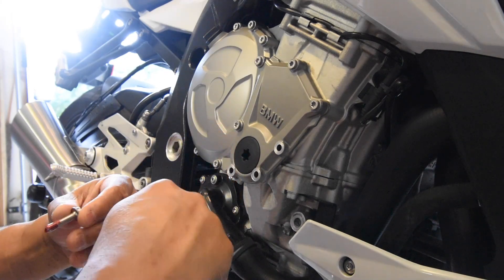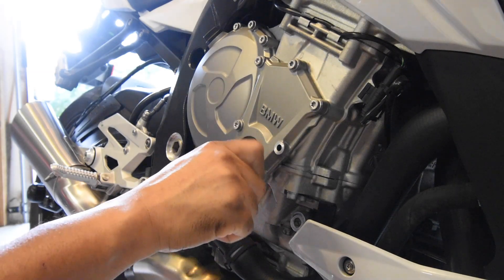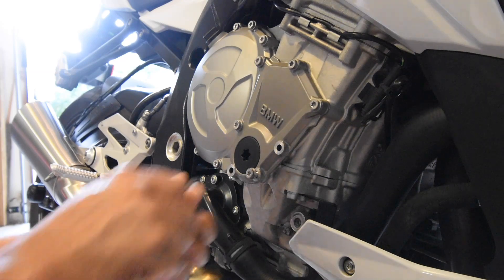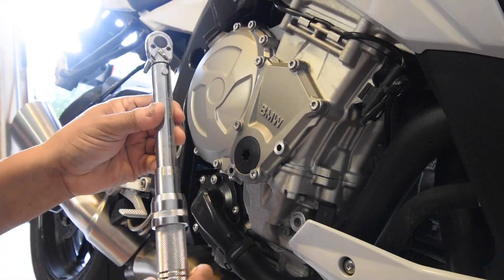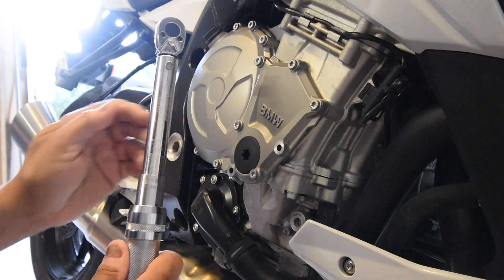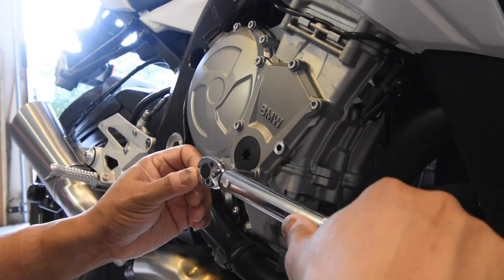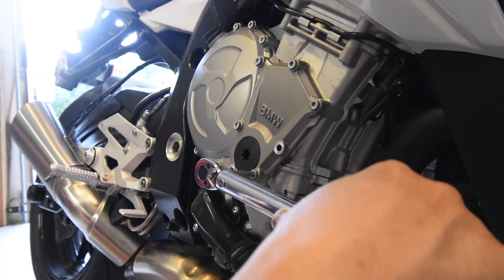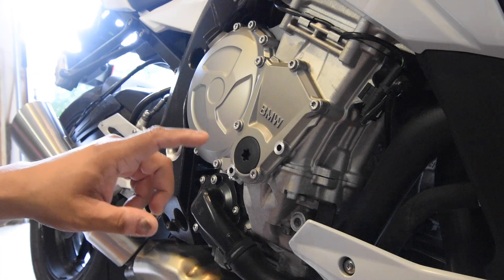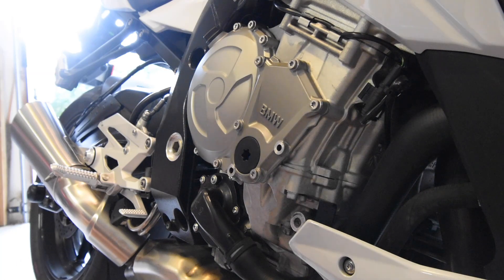The Loctite is a bit runny, so I stick it in there and tighten by hand. This small torque wrench only goes as far as 5.1 Newton meters, so I go down just past the lowest mark for what I estimate is three Newton meters. When I took these screws off earlier, they had less torque than I just applied — the torque was incorrect before; it was too slack.